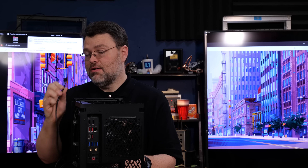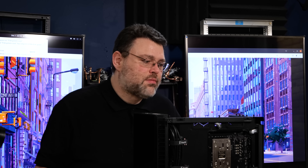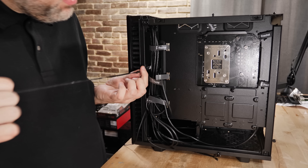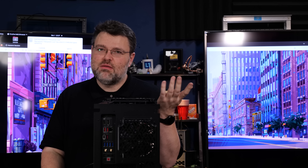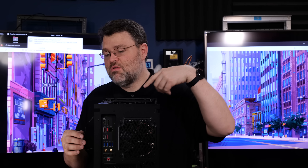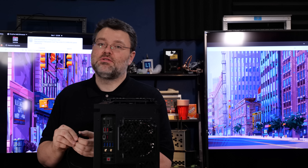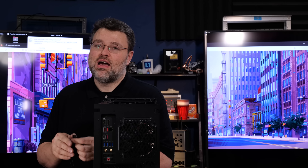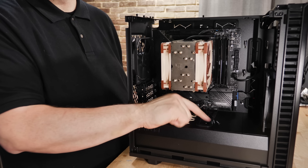Be careful not to confuse USB for front panel audio — just shove the cables through the rubber grommet. Route your fan connectors next. The front panel fan is a three-pin fan, meaning it's DC not PWM — that's just how the fan is controlled. There's an extra assist fan header at the top of the motherboard, so that's where I'm putting it. For front panel connections — power switch, power LED, reset switch — those go to a special place on the motherboard; check the manual for exactly how to connect them.